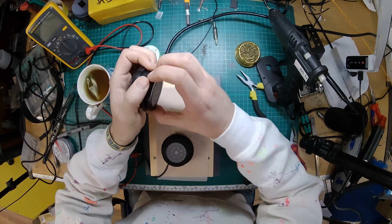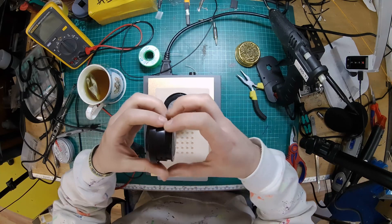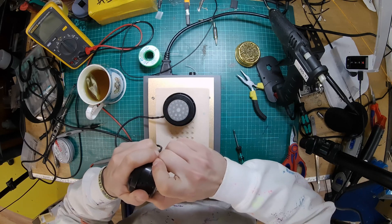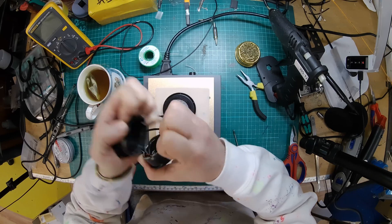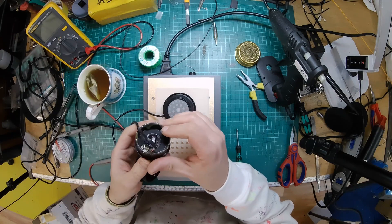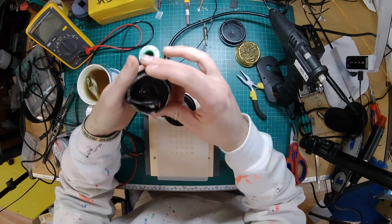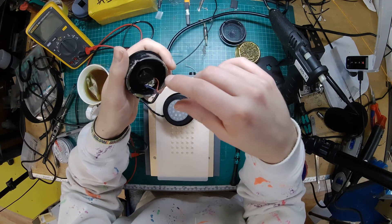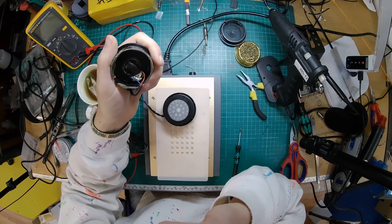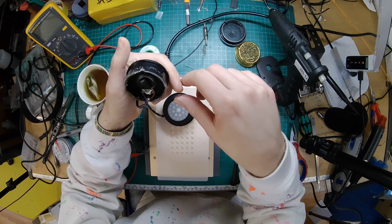I'm just grabbing the lip and pulling. This one's definitely moving. As soon as I take it off the warming plate, it starts solidifying. There — we've got it apart. Just lots of hot glue around the outside. Interesting. I don't know whether someone's already had these open — they might have done. But you've got some of that shmoo on the back of the driver, which you didn't used to have on the SR80s. That used to be a mod that a lot of people did — put some damping material on the driver.